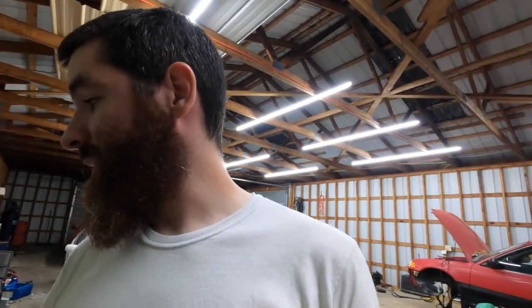So that's gonna wake this thing up quite a bit and definitely make it a lot better than what it was previously. Now that much lift is pretty crazy if you ask me. For an OEM cam to find that much lift in another OEM cam is pretty good. That's like going from a base B16 cam to a CTR cam or an ITR cam. It's definitely a big upgrade in the OEM world. I just told Yarrow and Frito, and they were pretty stoked about it. To see the big difference, they were like, whoa, that's crazy.